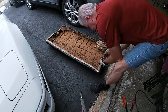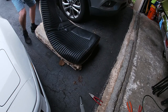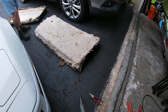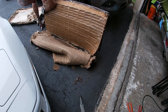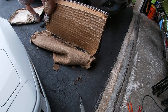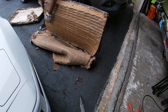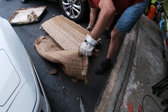The first thing to do is remove all the hog rings off the seat. Once the cover is off, I'll remove all the batting and then the burlap too. There are some additional hog rings you'll have to contend with on the batting, but a little time and patience and you'll get them all off. On this one there is listing wire inserted inside of the burlap — it's a special kind of burlap — so you'll just have to take your time to get it all off.